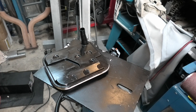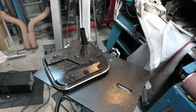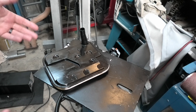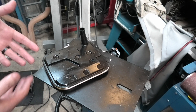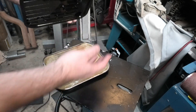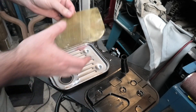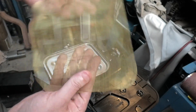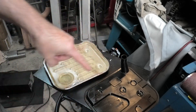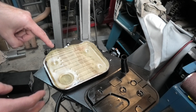It is high flow — for a very small amount of time — due to a quite significant design flaw, which I'm going to demonstrate. What I found, and what Jake's do, is they just get a cheap filter. I don't know if they do this in-house or they contract it, but this is what's done: they get a cheap filter, peel it open, remove the standard paper-style filter membrane, and replace it with some brass filter gauze — this stuff. Nothing wrong with this as filter material; it will do a really good job. But you really need to use the entire surface area.